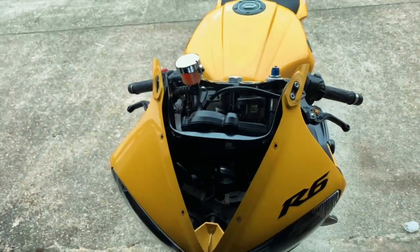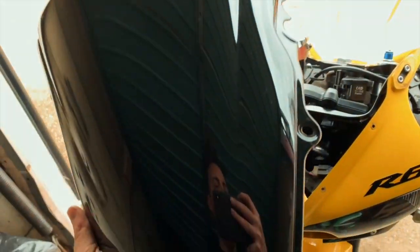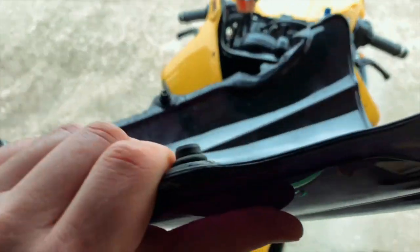What we've got to do now — this is the new screen. The new screen will slot in but we just need to take out the grommets, sort of like these rubber grommets with a nut on the end, to put into each of the four holes. This is the old screen and in here we've got one, two, three — I've actually taken the fourth one out already — but if you just put a screwdriver in there and push it through the other way, they do come out. Just manipulate them to get them out of their original holes. Be careful you don't split them, but they do come out without too much trouble.